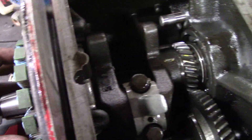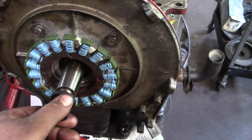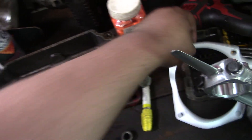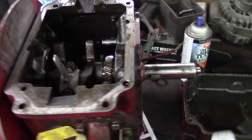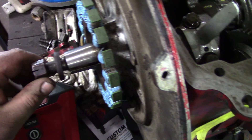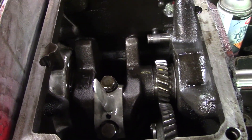When you're installing this crankshaft here, this is the plate. To establish the end play on the crankshaft, they give you these gaskets — it comes four in a pack. Now you're going to want to experiment. I put three gaskets on this: two of these and the black one. I tightened it and tried it. I don't need a dial indicator — I can feel probably about five thousandths. The spec is two to twenty thousandths end play, so this is perfect.